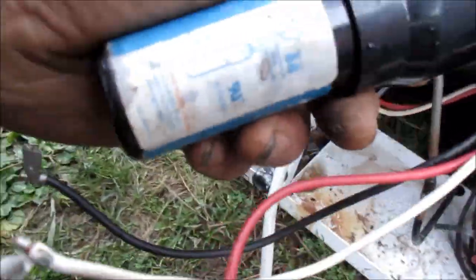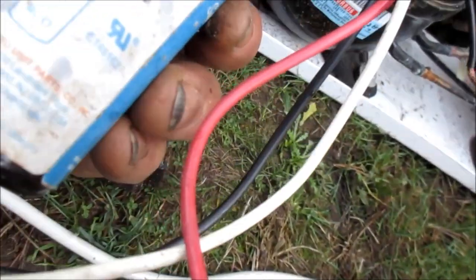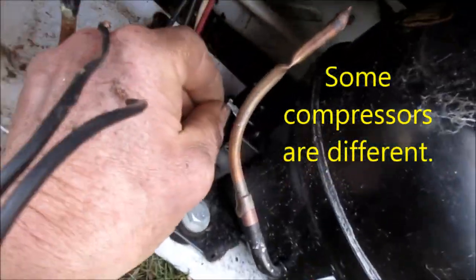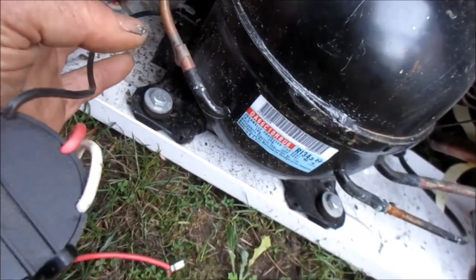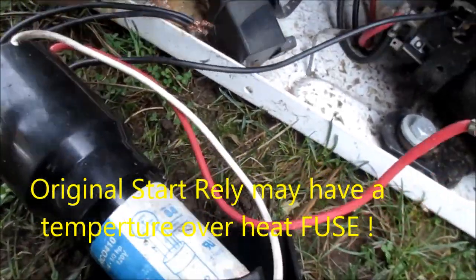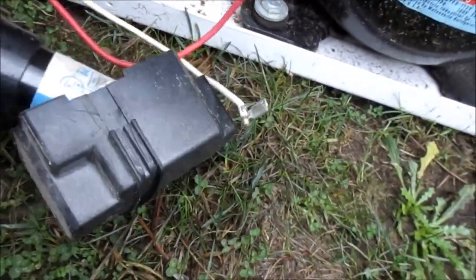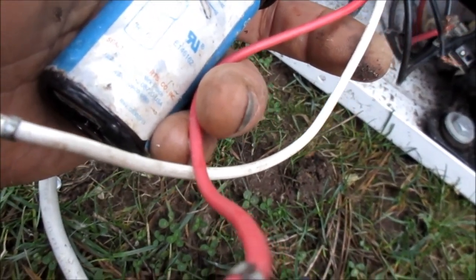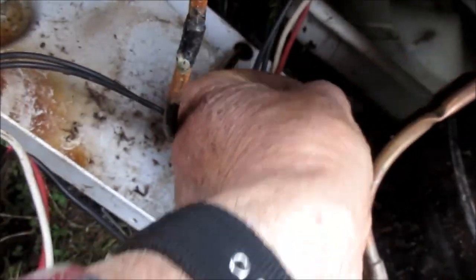Here is the hard start relay. The middle terminal on this is the neutral, and that middle terminal would also be considered the black wire — so this black wire will go on that middle terminal. This is the old start relay. I don't see a capacitor in there; there's probably a capacitor somewhere in here. Oh, here it is. This capacitor here could be shot — you can test them as well. The red wire is the run wire, and on this particular setup the run wire would be on the right.